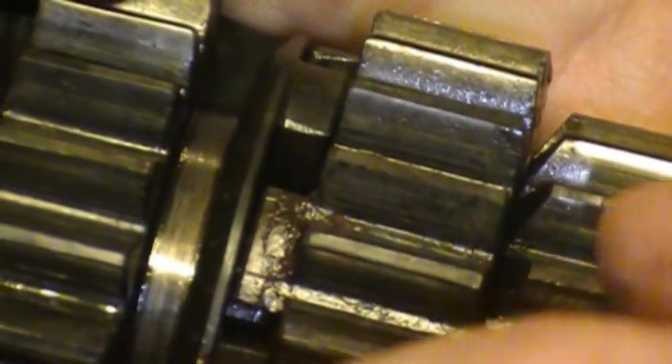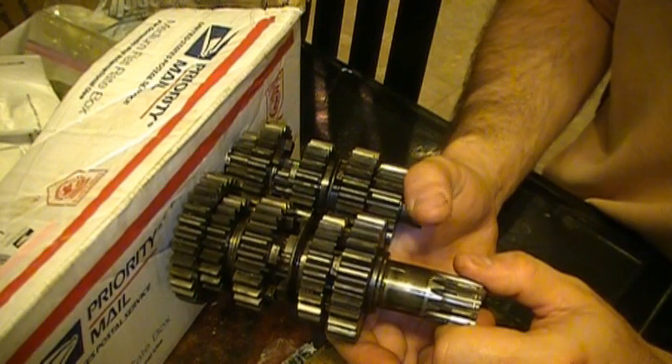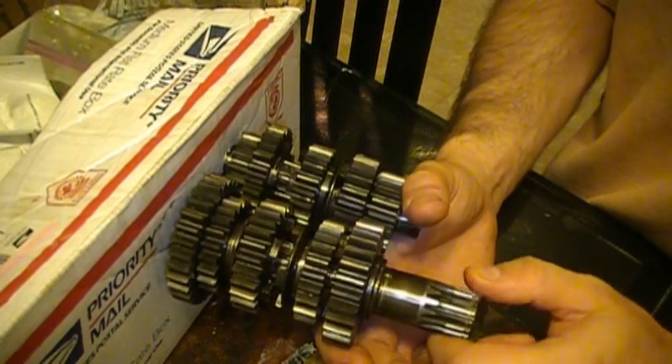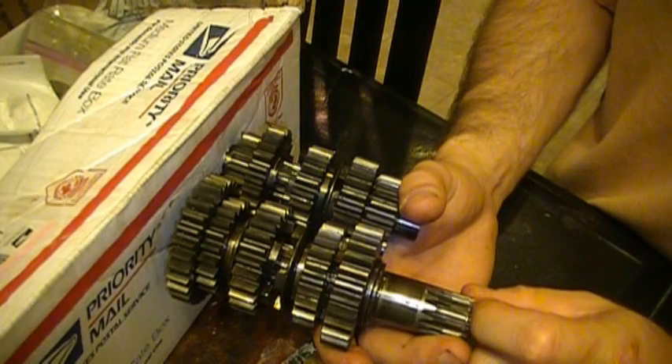As you can see, there is really nothing magical that the clutch does to prevent the transmission from wearing down or causing transmission problems. I've shifted without the clutch on my bikes for 20 years and never had a problem. Problems come from grinding gears into place or forcing a shift when the gear dogs have torque on them, whether or not you have the clutch engaged.